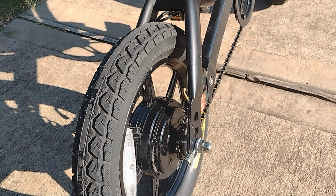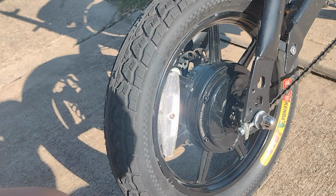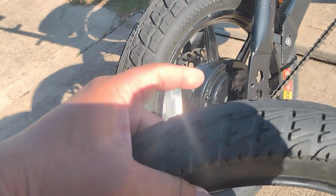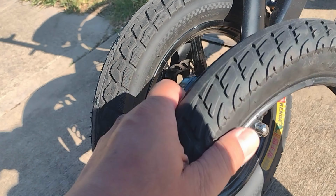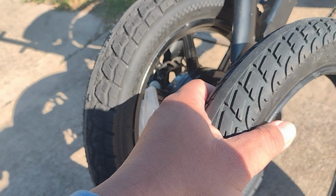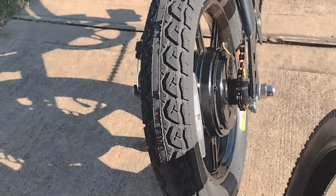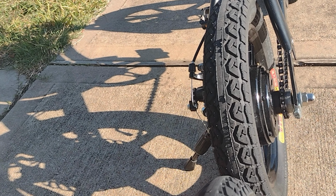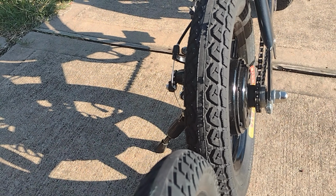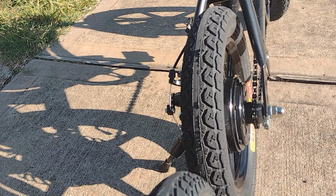So I tested it, but I did not check the speed, but I noticed that I am slower than with the 14 by 2.125. I did a speed hack on mine. I was running around 16 using the stock tires, and with the wider tire, without testing it, I think it's around 14. So I'm slower with the wider tire, but the ride is smoother,